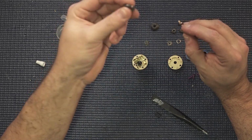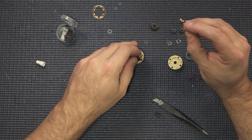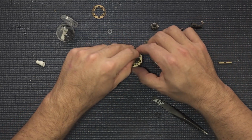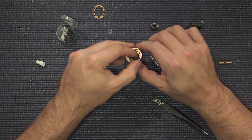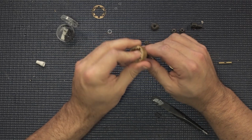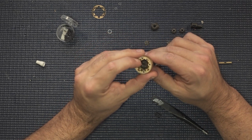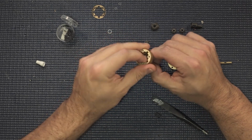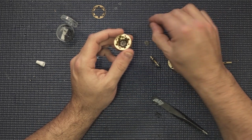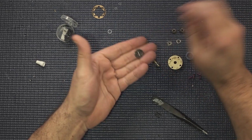But before we do that, we need to take one of these bottom gears of the planetary, stick that down in there. It's the reason why we wanted to have all of that nice diff fluid to start with. And you're going to need to just kind of spin it around, and you'll feel it click into place on the rotating pin inside there. And if you ever get to a point where nothing is working out, it's probably because you are not seated properly and you're not connected. This bottom side here, as you can see, isn't fitting inside of one of those pins like that.